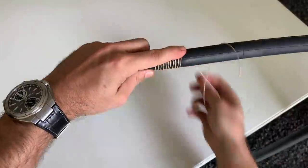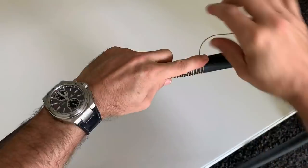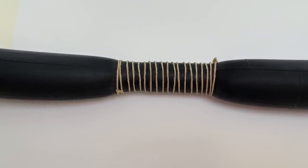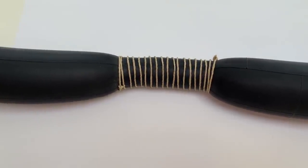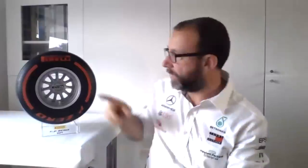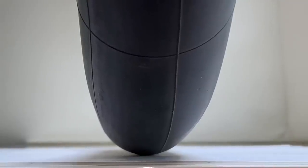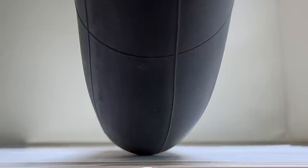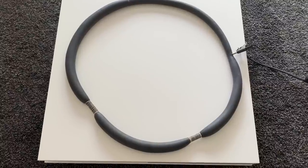You need these cords inside the tyre to give the structural strength. You have all these cords embedded into rubber, and the rubber allows you to seal the air that you're going to inflate the tyre with. When you pressurize your tyre, all the cords will go into tension and then you achieve the shape you want, because the tyre is not like a ring. If you look at this tyre, its profile is very flat — nowhere near a ring. If you inflate an inner tube, it just goes bigger and circular, but you don't get the flat profile you want from a racing tyre to maximize your grip.